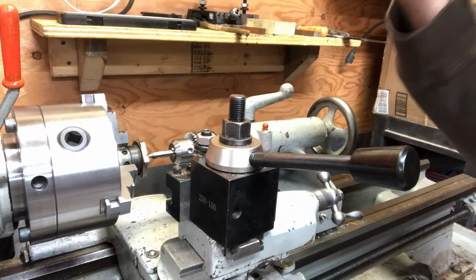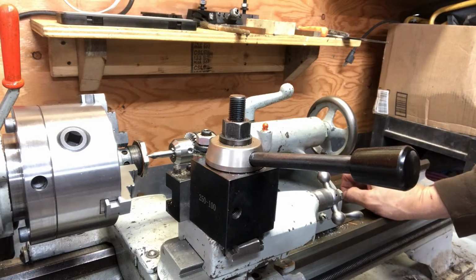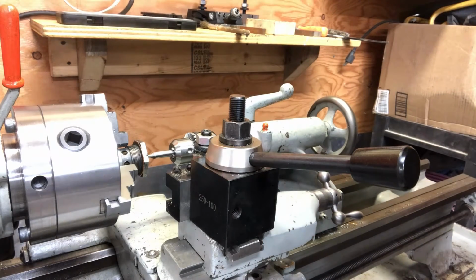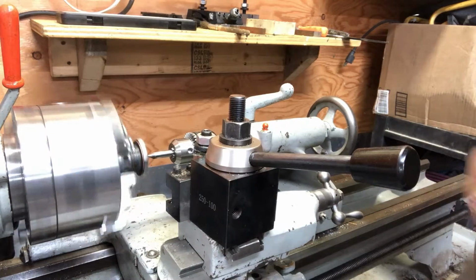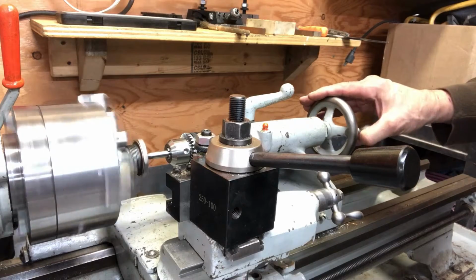So I'm going to drill and tap mine and put, I don't know what size, maybe an 8mm little bolt in there so I can undo it and drain the oil. If it ever sumps or it sits all winter, I can just undo that little bolt. It's hard to get a big wrench on this thing, so that's what I'm going to do. Chucked up. Find the center.